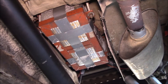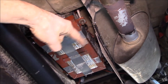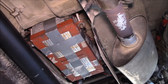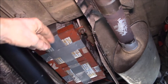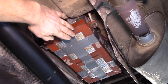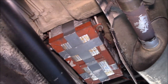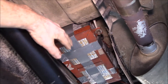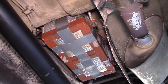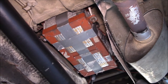Got the batteries back in there. I put the four studs in place, put the bottom nuts on all four corners, and with the floor jack lifted it up to get the back two studs through the floor. My jack was maxed out height-wise, so for the front studs I had to lift the front of the batteries and slide a wedge under that end to get them through. Then I tightened everything down. You can see the heat insulation on the bottom, a piece on the side, and the extended heat shield — that should keep the batteries a lot cooler.